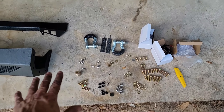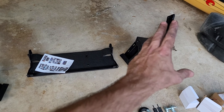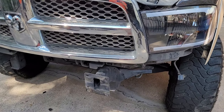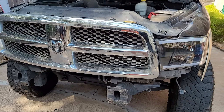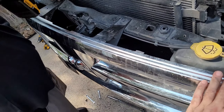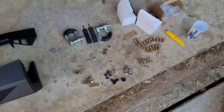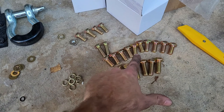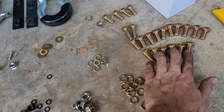All right, so this is all the hardware. We're going to start bolting it all together here — not including the winch plate. We're going to put just this part of the bumper together, and the winch plate we'll put on afterwards so it connects to the back. One thing about these bumpers: there is a difference between 2013 and up. These bumpers are for 2013 and up, so you can still put this bumper on a 2012 or older but you have to change the grill, which is what we're going to do also. We're going to go ahead and remove the grill. The hardware breaks down as 10 bolts — five on each side — and four bolts, two on each side, and then these go into the frame itself.